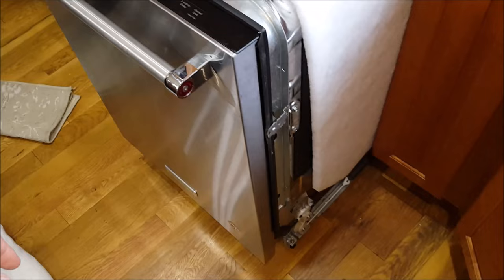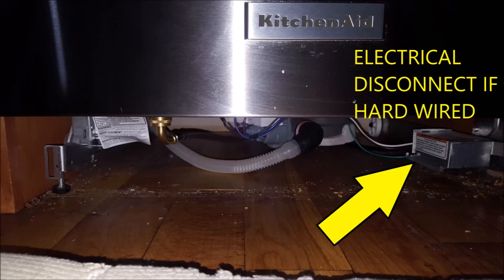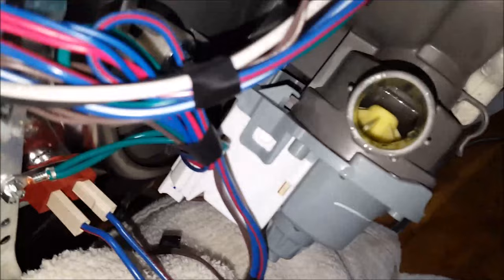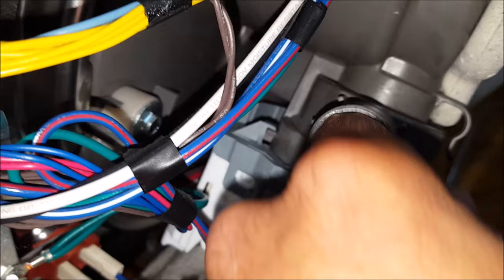There are also two screws that secure the dishwasher, located either on the sides of the cabinet or at the top underneath the countertop edge. After removing the screws, the dishwasher should pull out — you may have to guide the water line, drainage hose, and electrical cord at the same time. Note that sometimes dishwashers are hardwired, so make sure to go to your breaker box and kill the power before disconnecting the electricity. Here I have the dishwasher pulled out and laying on its side. I can now see where the drainage pump is, so I'll disconnect the drainage hose and take a look inside the pump, using my finger to feel where the impeller is located to see if anything doesn't belong.